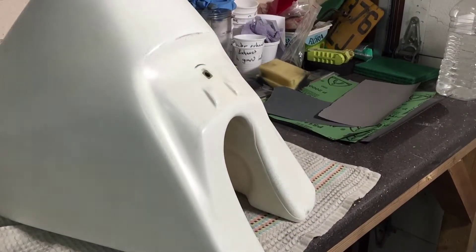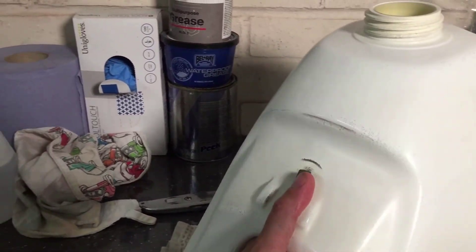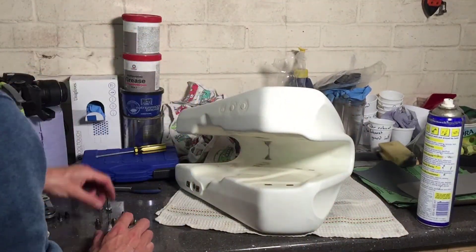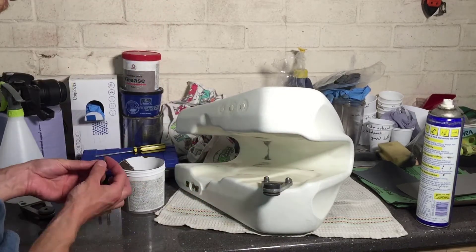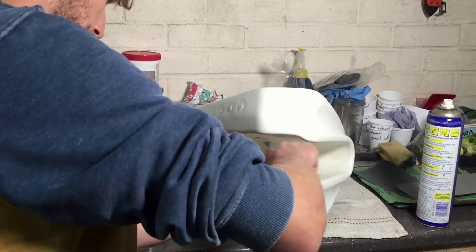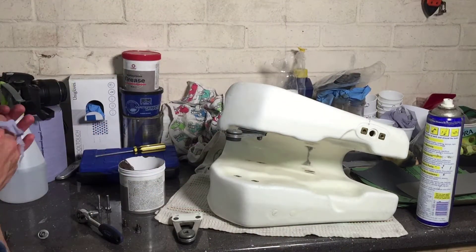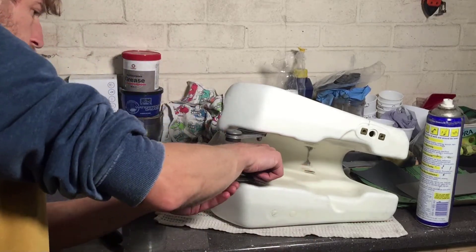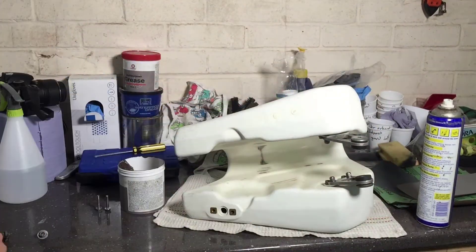I will say I am going to experiment with going up to a 2000 grit because I tried it on a fender and the result was quite nice, so I think the tank may benefit from that. With the tank polished up it's time to get the fittings back on. I've cleaned them — there's the bracket which goes onto the frame and also another small bracket which fits between the frame bracket and the tank. I sanded those and then sprayed them with primer and then white to match the tank, and then just put a lacquer over them. Then I'm reinstalling the fuel tap and the tank's good to go.